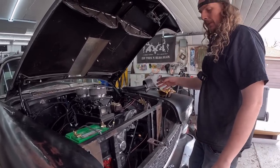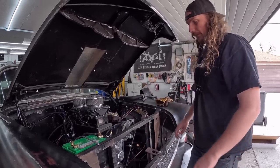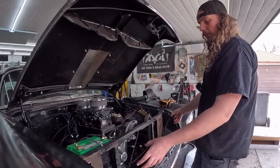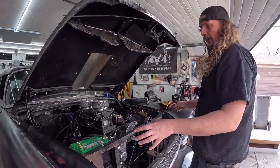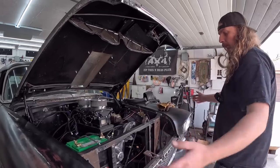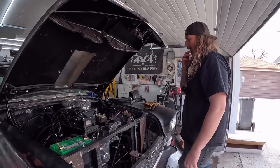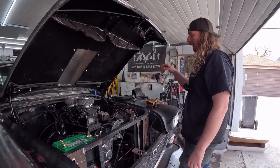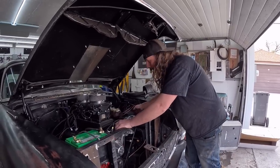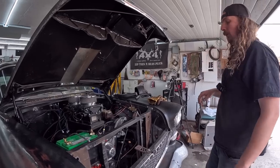But the way I looked at it was, to take the core support out is 1, 2, 3, 4, and then two bolts down there. Then a little bit of screwing around, getting these side plates off. Versus there's four bolts to hold the fenders on, and those two, you can take the whole front clip off. So if you have to do a motor or something like that, the clip's coming off this thing, which is what you do anyways on a Tri-5. The only thing we'll have to move would be the brakes, they've got to get disconnected, and a couple of wire looms on each side. Whatever we have, folded in, whole front clip is off, life's good.